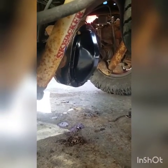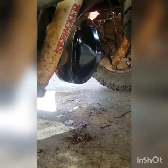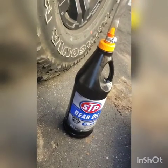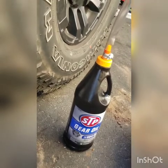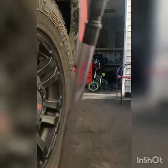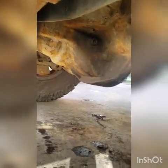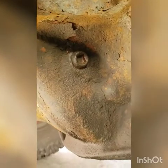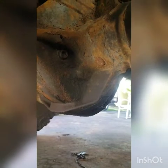As you can see, we've got our diff cover back on. I just tightened it down in the X pattern like I showed you. It's been probably an hour and a half and got it all tightened down. Now I'm about to add some fluid to the differential. I bought a gallon of gear fluid because it was on sale - standard 80-90 weight. I had a funnel with a rubber little hose connected to it, kind of like a pour spout, so I jerry-rigged it up. We're going to go ahead and see that drain plug right in there - we're going to pop that out and fill it up and see how much she drinks.